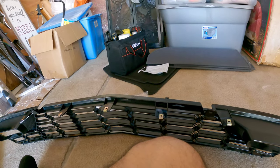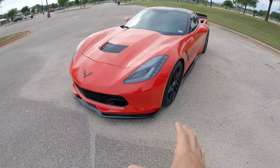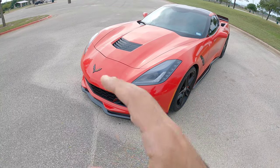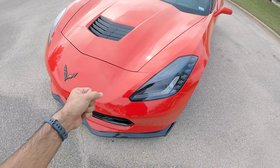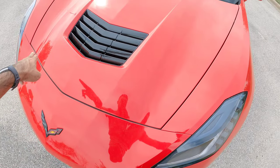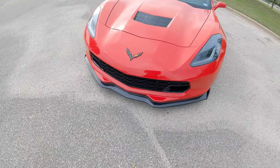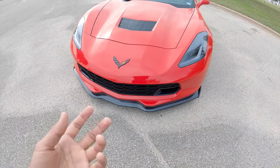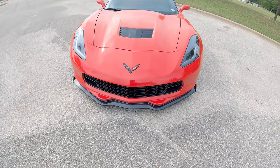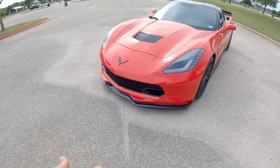Go ahead and finish up. So here's the end result. I was taking apart the bolts and screws to get the front bumper off. Once those are done, the front bumper will pry off — given you've taken off the screws on the bottom of the car and the ones aligned along here holding the clips. The bumper comes off, and then there are clips holding the stock grill to the front bumper — they're easy to take out. Once that's done it's a pretty straightforward process: get the new one in, reverse everything, and you're all good to go.